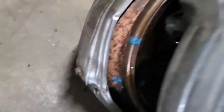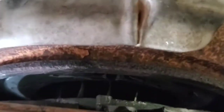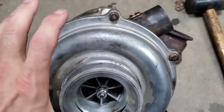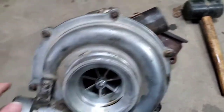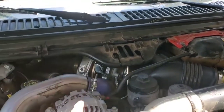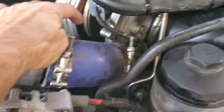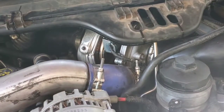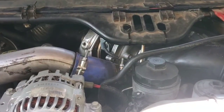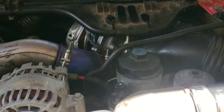When putting the turbo back together, I line up the pin on this side, keep the edge slightly up to line up the lever for the solenoid with the hole, and once I can feel it move back and forth slightly I'll flatten it out and tap the edges with a rubber mallet to seat it down. The video isn't too detailed, but I wanted to point out that when the plate corrodes and can't change position, you lose all your boost. There are a couple of bolts — one on each side and one in the back — and once those are off the turbo comes off. It only takes about an hour or two. Thanks for watching — if you haven't already, please hit that subscribe button, like it, share it, let me know what you think in the comments below, and I'll see you in the next one.